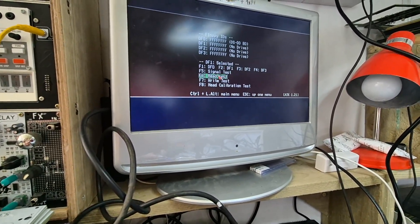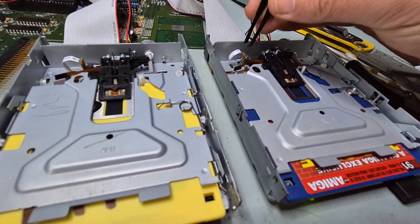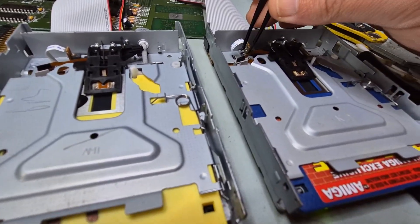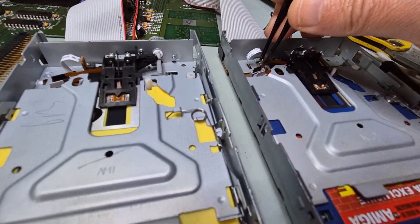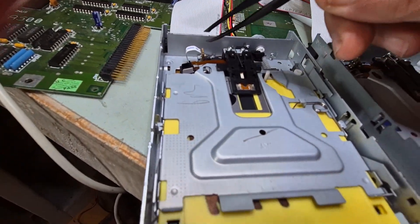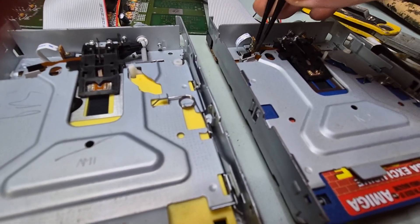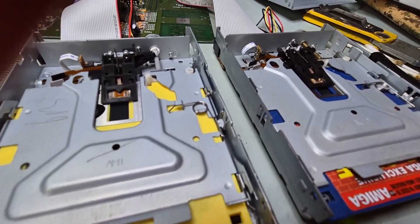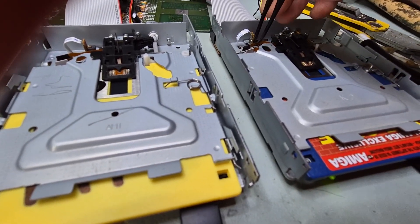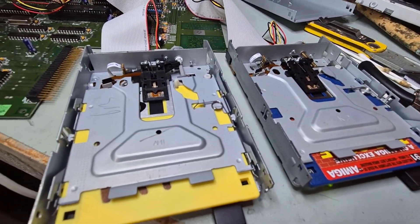And it's reading as well. I had the hardest time getting this drive to work properly, even though I did everything that should be done — which is not that much. Essentially, there are two ribbon cables here that go to the head and these probably need a clean as well. I've done this one and it worked right away. Remove them just carefully like that. A little bit of oxide in the connector and clean on the ribbon cable and you should be good to go. This was the only way I could get it to work. So I'm going to do the same thing here and test again and report back.